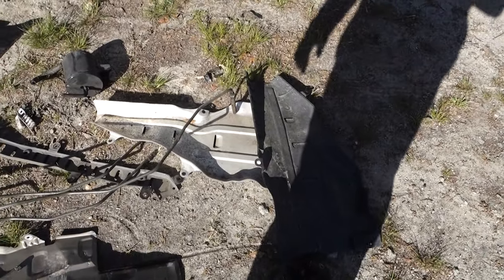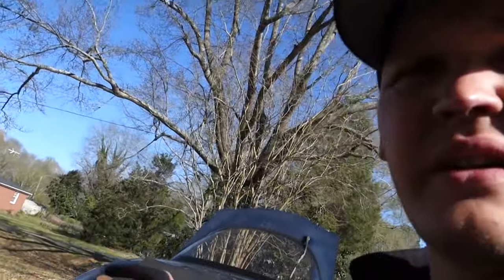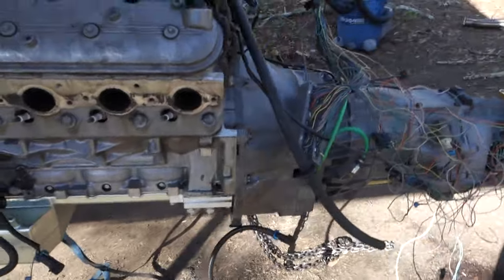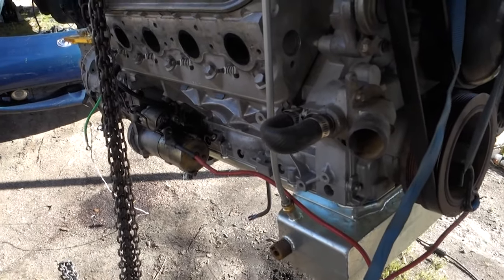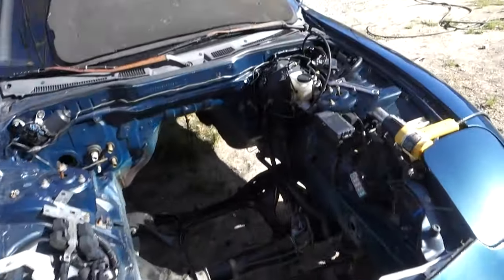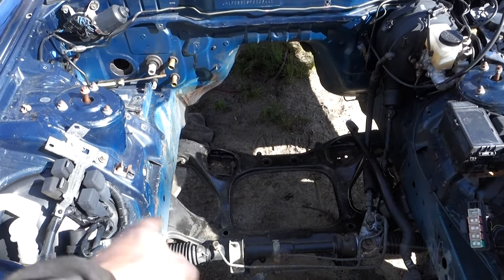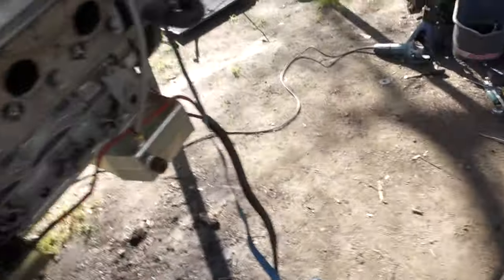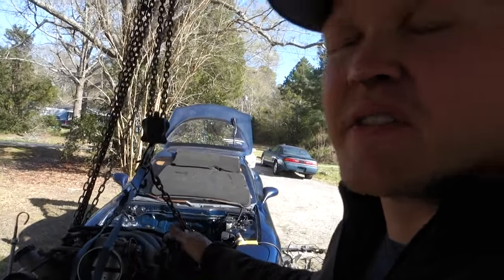I got all the heat shields out of the way. For the fuel system, you can use the factory setup, but I like to use a little Corvette fuel pressure regulator and filter combo — makes life easy with just one line running to the front. I'm going to paint this stuff and let it dry since it's warm out, then switch the oil pan on the LS-1. I also need to pull the fuel system and swap kit off the white car and take the K-member off so it can roll around.